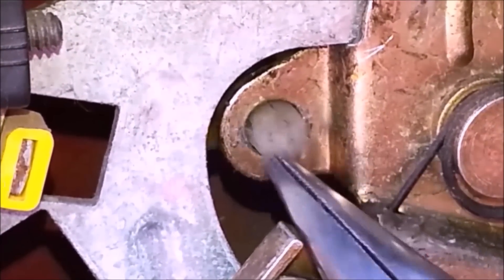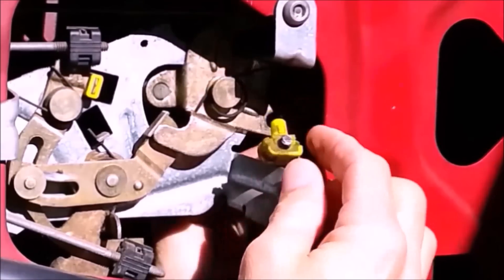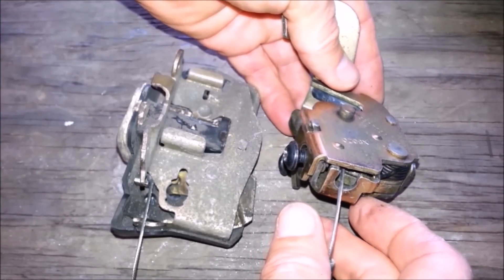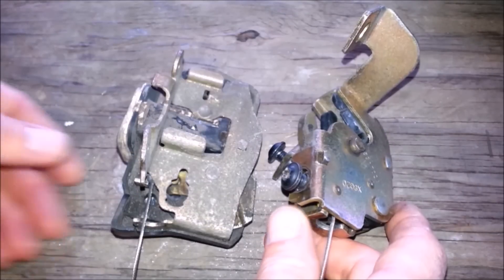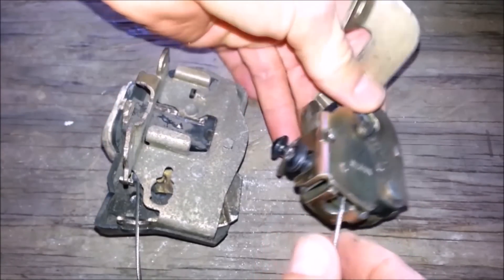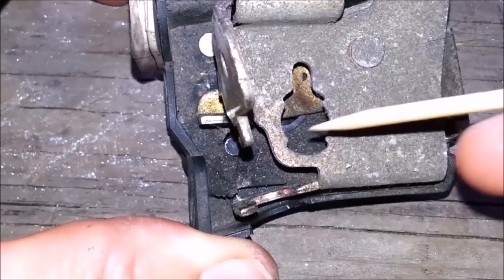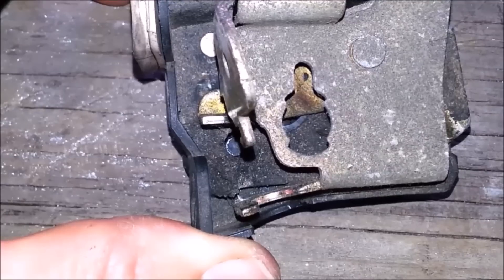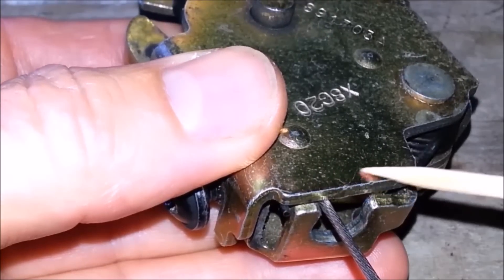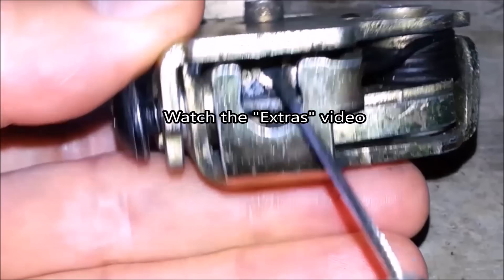Disconnect the handle end of the cable. Remove the screws from the latch mechanism and pull the latch and cable out of the door. There's an upper and lower latch in this door. If you're repairing a latch cable, chances are your latch will have a similar housing attachment point to one of these two designs. For the latch on the left, the housing attachment point is only partially blocked by a piece of metal, so it isn't too hard to come up with a new method to attach the cable housing. For the latch on the right, the housing attachment point is covered by a piece of metal, making a new cable housing end a little harder. If you want to remove the cable to make it easier to work on, I show how to do that in the extras video.